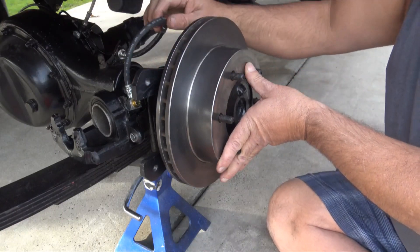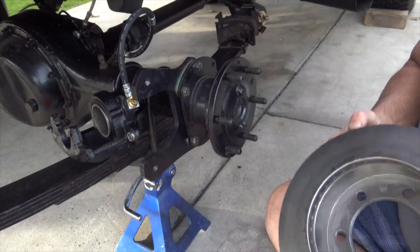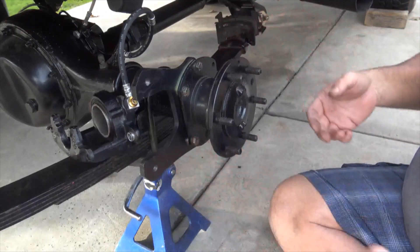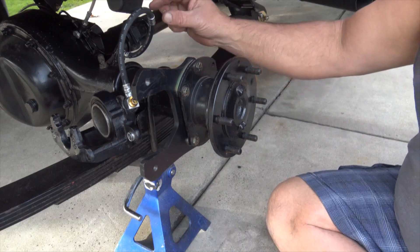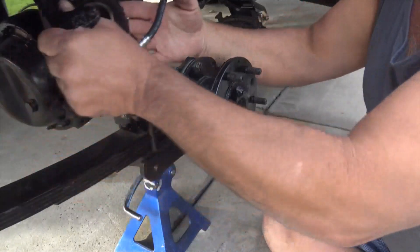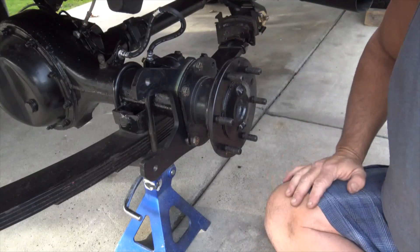It's very, very simple to do — no cutting, no changing of anything. Just the standard Trail Gear milled rotor, the bracket, and the '75 Camaro caliper. I run a soft line just so that whenever you take the caliper off you can move it around and have some freedom. If you run a hard line to it, it just makes it hard to work with in the end.